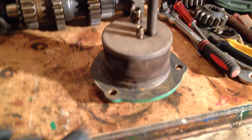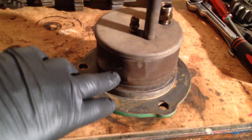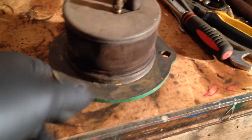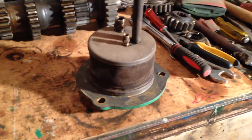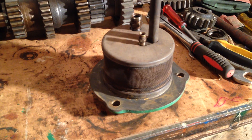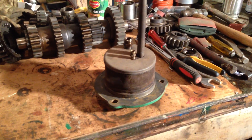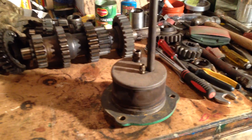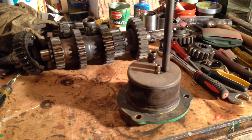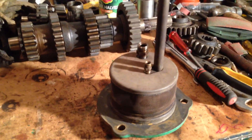As you can see, there's a large screen area right around to filter out all the big bits of muck, and then the oil filter behind the pump does the rest of the work. The oil pump pumps the oil through the filter, so it pumps all the crud through itself first, then through the filter, and then the filtered oil is pumped through all the engine bearings.